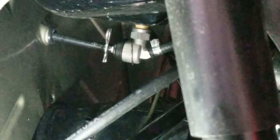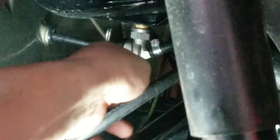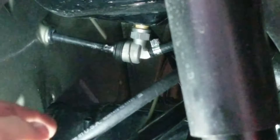And then disconnect it from, I wasn't disconnected from there, but I'll try to crimp it and cut it. Crimp it and cut it will be a lot easier than trying to remove it from the fuel pump. So first, we got to disconnect, we got to pull off this clip. And usually I just use a pair of needle nose to do this. But we'll see if we can get it right. Oh, there we go, got it. I'm gonna go inside real quick and pull it off. You guys can watch me pull off the reserve lever.